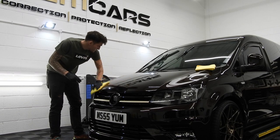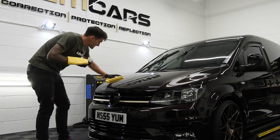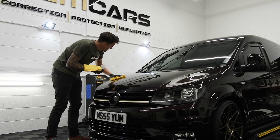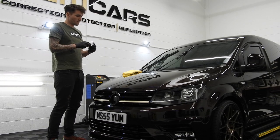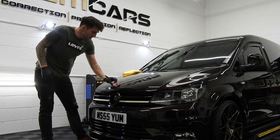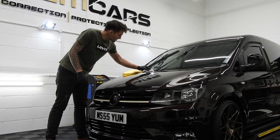You can feel the slickness on this one guys, it's immense. Like I said previously, this is a two-step ceramic system. You can see it's very slick — you've got a very thick base coat which actually adds thickness to the paint, and you've got a top coat which is extremely hydrophobic. That's what provides really serious water beading and protects the base coat. I'm doing larger areas on the bonnet because the ambient temperature is not that hot — it's about 7 degrees outside — so I've got some time to play with.